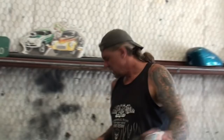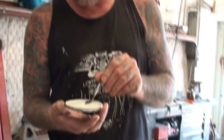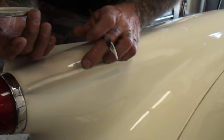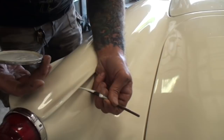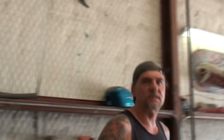Now what we've done is filled that big chip in, but we've got to come back and fill it in again. I'm going to take my paint - this white paint looks like the right color, but it doesn't match when dry. I'm going to touch it up one more time, just getting the paintbrush wet enough to dab it on there. You can see this crack went all the way around here, so I'm dabbing it on lightly, staying inside the line where the chip was. We'll let that dry and repeat the process - sand it down one more time.